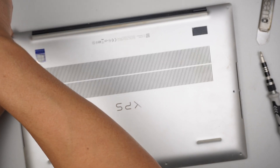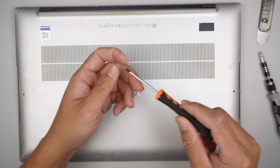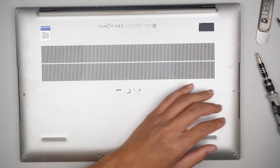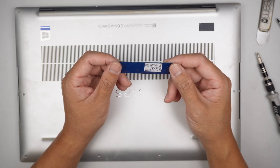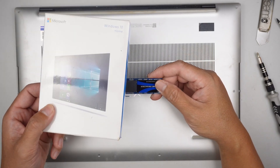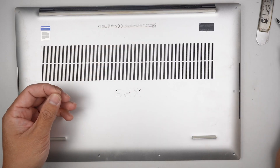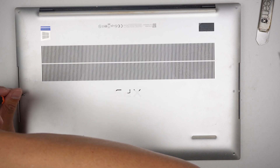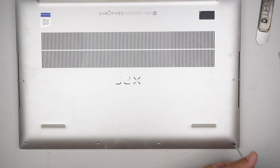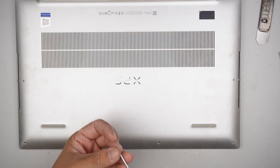With the new hard drive you're going to purchase — if it's from Dell, more likely they have installed Windows on it. If you purchase it from Amazon or a third-party seller like eBay, you do not have Windows installed because those M.2 drives you buy from Amazon are just blank; they don't have anything on them. So what you have to do is buy a USB installer, or download it and create one yourself from the Microsoft website. You just need a USB — I think 16 GB or higher — then download Windows, set it up as a bootable USB, and fresh install Windows onto the M.2 drive.